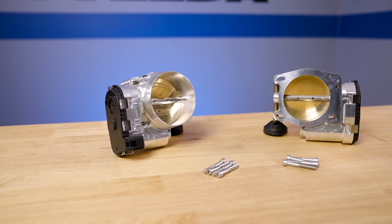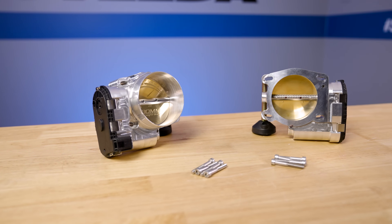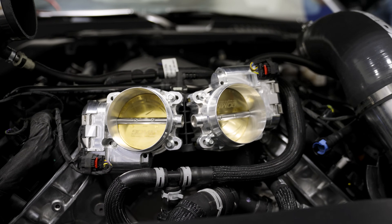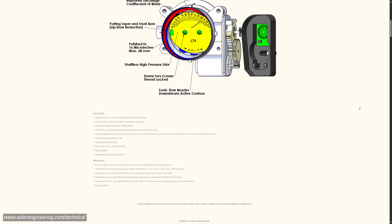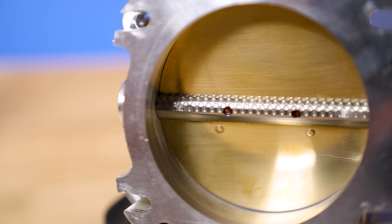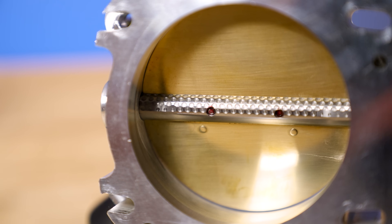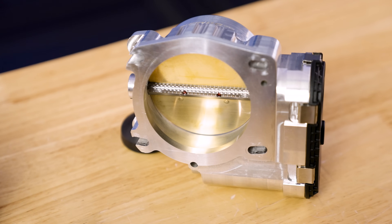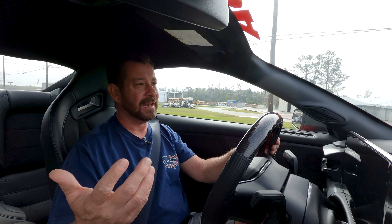This car is so much fun. Solar Performance not only makes throttle bodies for the S650 but also for the S550, Corvettes, and other applications — it's really their bread and butter and they make a high-quality, very premium product. On their technical page you can completely geek out over all the details, even the back of the shaft where, after the throttle body opens up, they've got little dimples all over it, similar to what you see on a golf ball. Golf balls have those dimples to allow them to travel further by reducing turbulence, and that's exactly what they're doing here — reducing turbulence to maximize airflow and performance.